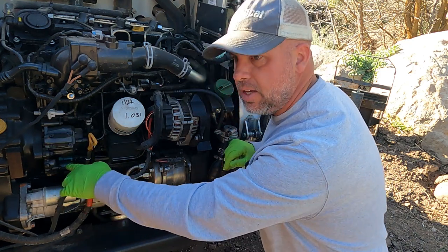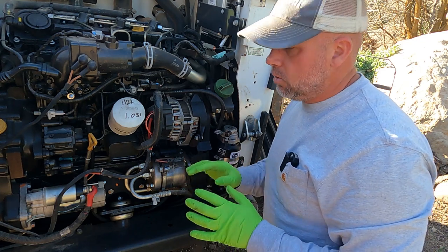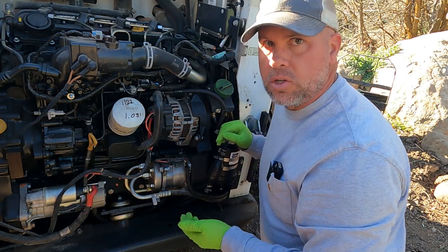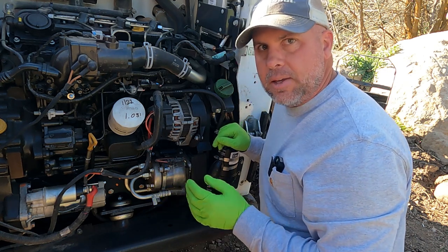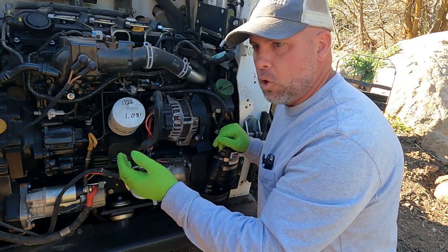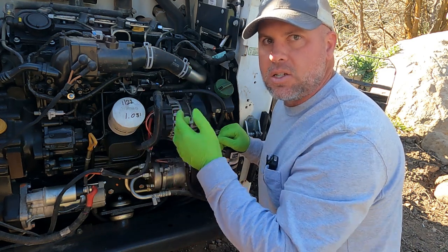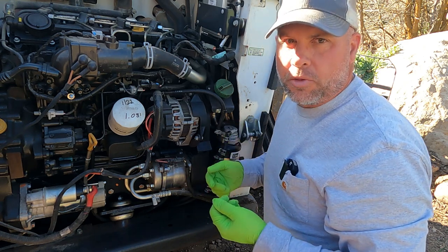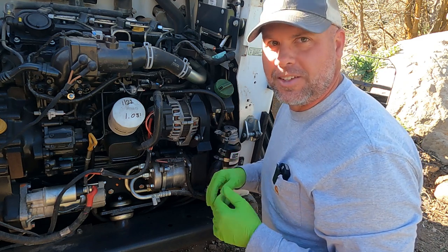The injection pump has an IMV — inlet metering valve — and that controls the rail pressure. When it's calling for rail pressure, this IMV is going to be wide open trying to meet that demand that the computer is asking for. Since I don't have any IMV codes, I'm just going to assume there's nothing wrong with the IMV — it is opening and doing its job because the ECU monitors that. If I had a problem with it, I would have a code on the dash. The only code I currently have is low rail pressure when I try to start the engine for more than three seconds and it doesn't fire — that E001076-16 code pops up.